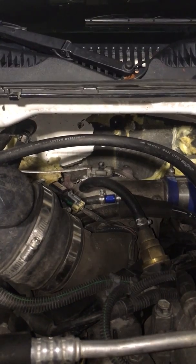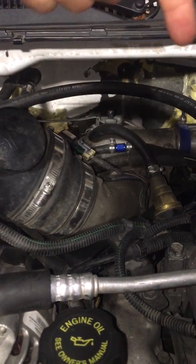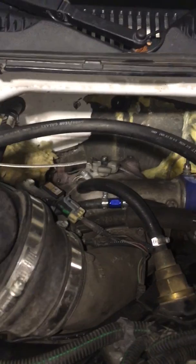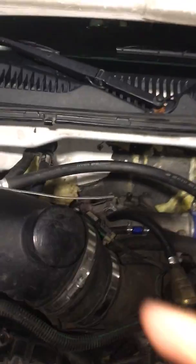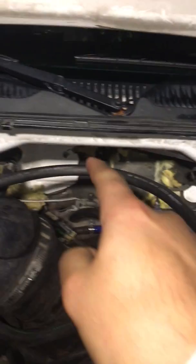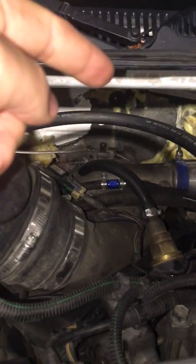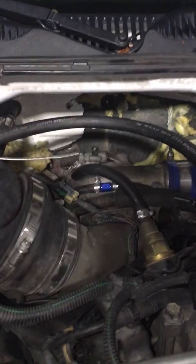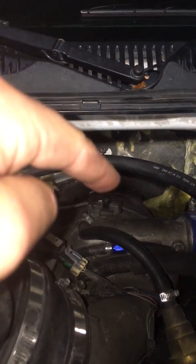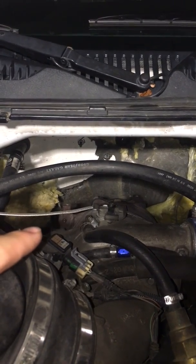There's another guy on YouTube who used a serpentine belt tool, just a long piece of metal. You put a socket on one side, and it comes up this way with an extension bar coming out. So rather than trying to work at it under the motor, you can get it coming back at you. I had the socket on it, the tool extension coming out, and then a breaker bar. I broke the top 3, and then I threw a 14mm on that serpentine belt tool and broke that one. So those got me the 3 of the 12 points, and then the 14. The 12 point underneath and the 14 on the side were a pain.